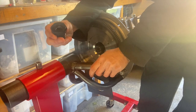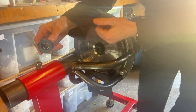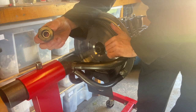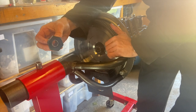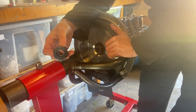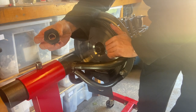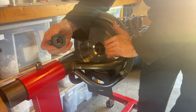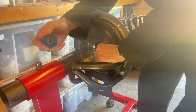I'm going to have to replace this because when I torque down my flywheel I use the Torque Meister — or the MP torque tool — to get the right foot-pounds on the flywheel, and the Torque Meister doesn't work with 38 millimeter across the flat; it only works with 36. I'll get the tool out and double check before I buy a new one. I could get a 38 millimeter socket but then I'd have to buy a very expensive torque wrench to get up to the required foot-pounds — they're like over 200 pounds. Hub nuts and these things are the only items I work on that go up to that torque level.